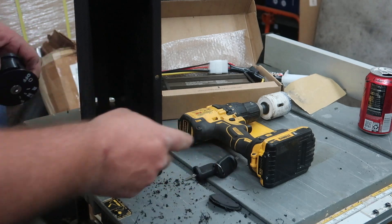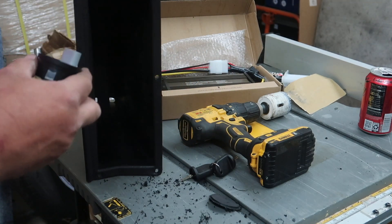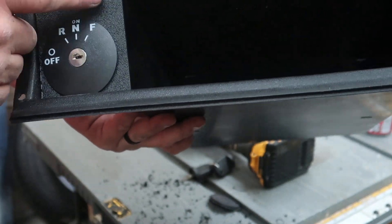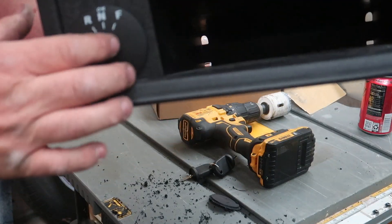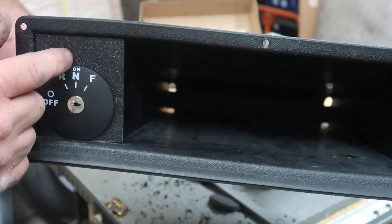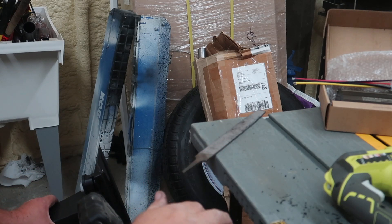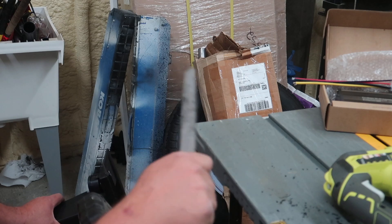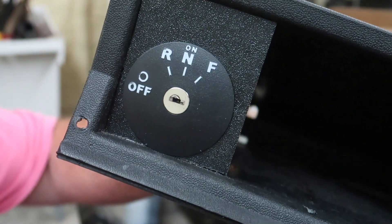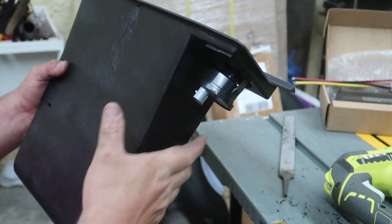It's got these notches at the very top of the switch and you can notch the plastic out if you want to. The RXV key switch is now in the dash — I think that looks a lot better without that hole. I'm going to go ahead and try to notch out the top one just a little bit, maybe the bottom one just a hair. You don't want to go too much because you don't want to go past where you can see it, so be careful. I started with a jigsaw but didn't like the speed, so I found my file, and a little while later we were able to make it fit flush all the way around. It won't turn left or right — that's good to go.